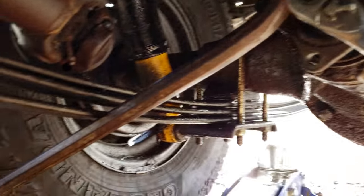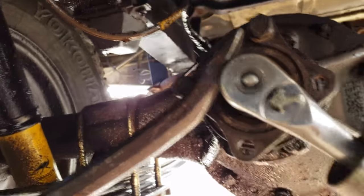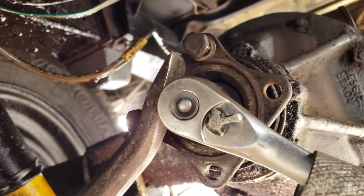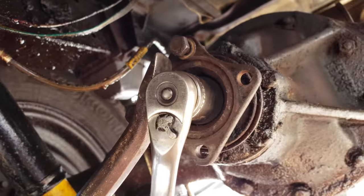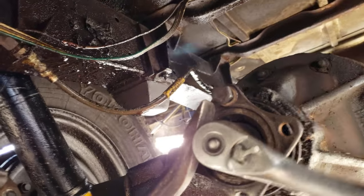So this is how I broke it loose: I've got one pry bar going up holding against the bolt — it's actually running against the socket. When I torque it up, I'm going to grease that real good with some anti-seize so there's little to no drag between the socket and the pry bar. Then I've just got a little cheater pipe on my socket wrench and she's coming out real easy.